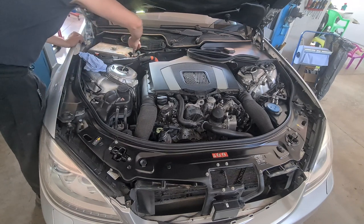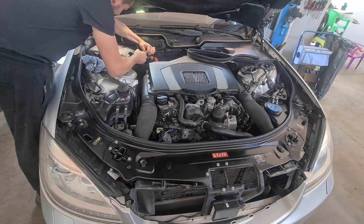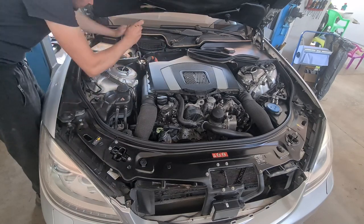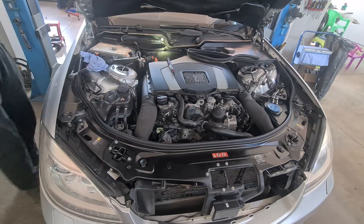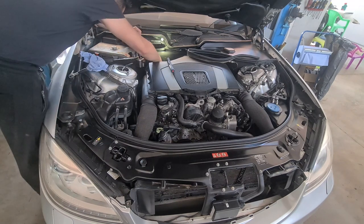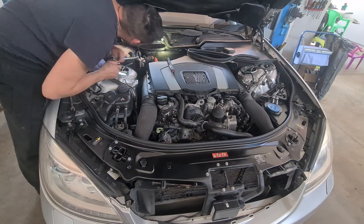In the beginning, I unscrewed the bolts from the plug that connects the high voltage cable or harness to the high voltage battery. I need to remove different parts throughout this job for better access, so that in the end I can easily remove the inverter from the car, which is mounted right on the right side of this engine. The voltage cable is also fastened with a bracket onto the firewall, but it is a simple one to detach.